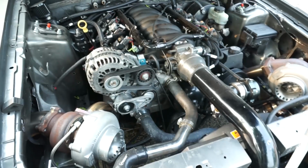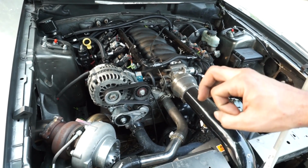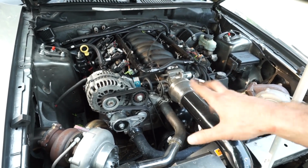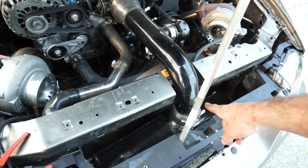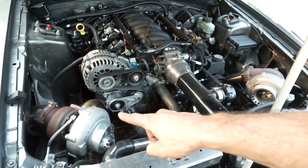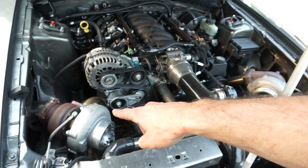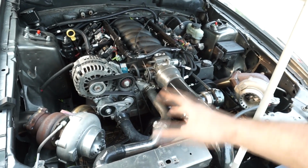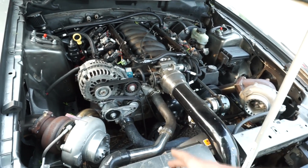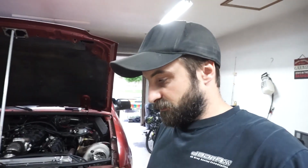So now I'm going to make a couple different files for him, where he has 0% controller, because this is at 100%, it's like 97% right now, and it was still making 8 pounds with that big crack in it for some reason. These two springs at 100 pounds was making 8, but this is going to make probably 10 or 11 now at 0. So I'm going to make a few different files, so he has a file for 0, and then a file for, I don't know, maybe 40%, 50%, 60 or something like that. Alright, so that's about that.